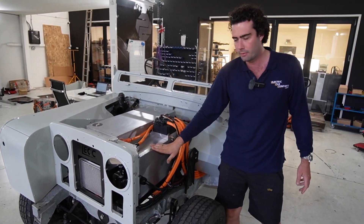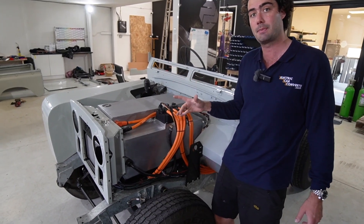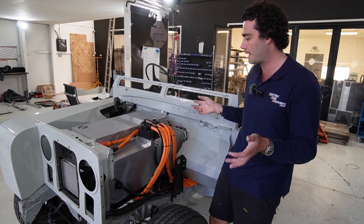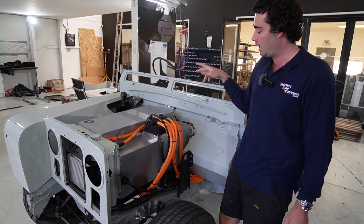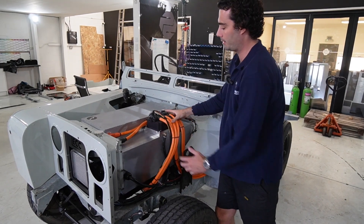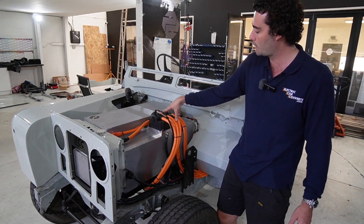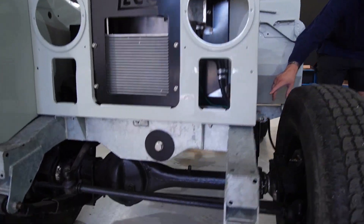Now, in this beautifully made aluminium box, there are seven Tesla Model S batteries. That gives you anywhere between 37 and 44 kilowatt hours, depending on which modules are in there. But more crucially, it gives 144 volt nominal, which is what the Hyper9HV takes. You'll probably recognise this inverter as being a Hyper9HV one — it's taking two phases in, spilling three out, which go underneath to the motor, which is under there somewhere.